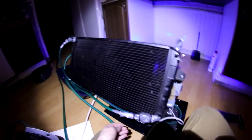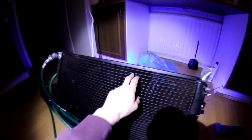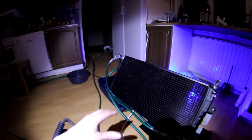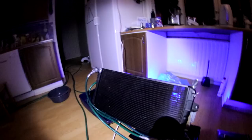When I started I thought I'd put the intake at the bottom and the outlet at the top, but I'd actually accidentally done it the other way around. That didn't work very well because any air that entered through this horrible leaky, crappy radiator — it's full of oxidation where it was leaking when it was in the vehicle — all of that air just got trapped in here and the water level would go down and down. The pump is so weak there's more pull on the outlet than push on the inlet, so the pump couldn't keep up — it was at negative pressure, sucking in air rather than leaking out water. Perhaps that's why the leaks have cured themselves, because it's so low pressure that the water just doesn't want to go anywhere.